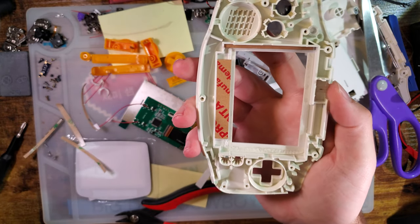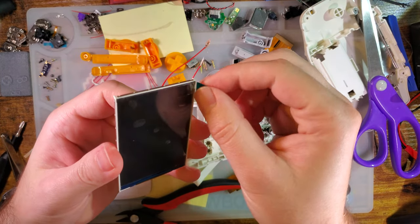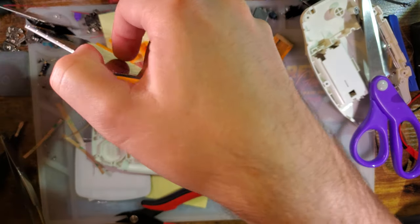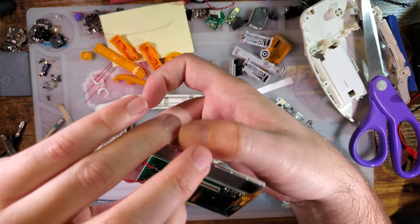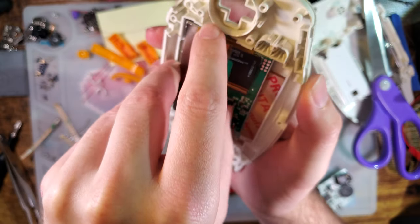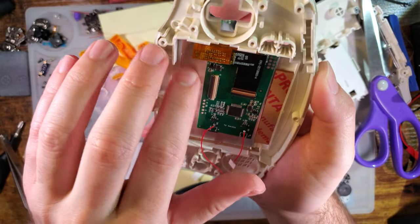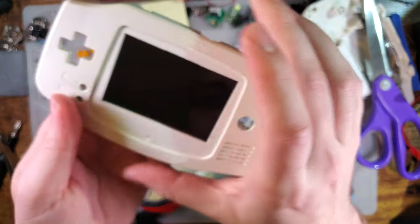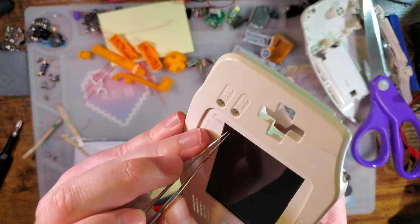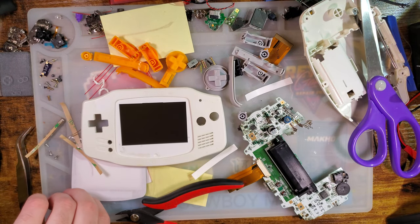If you're using the flat adhesive like I am, that absolutely has to be trimmed flush. If it's not flush, you're gonna have a hard time. If you're using the adhesive that it comes with, there's some leeway in, try not to do that. In, we want it pressed up against both of these spacers, and that should go down just like that. I got extraordinarily lucky with the dust. And then let's drop the screen lens in before I touch it.